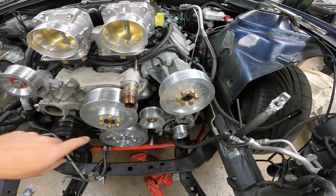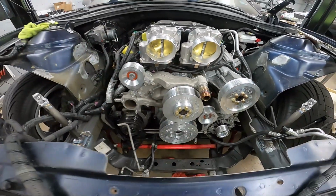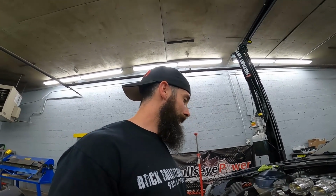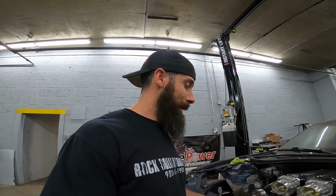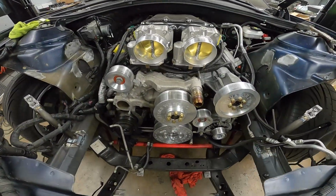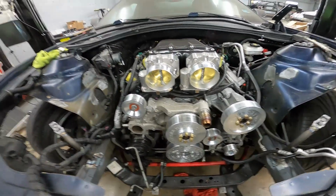Like I said, the best way is probably to grind that out and do it like a power steering pulley. That way you can use the same puller and it comes off pretty good, thanks to the guy that I seen on YouTube that had actually done that. I think he had a little bit tougher time than I did with it, but I didn't want to mess up the shaft or anything on the water pump, so I just went straight to that method first, and it seemed to work great. So hopefully this video will help some other guys that are going through this, and maybe it'll go pretty smooth for you. So that's that. Innovators West billet pulley setup for 5th Gen Camaro. See you later.